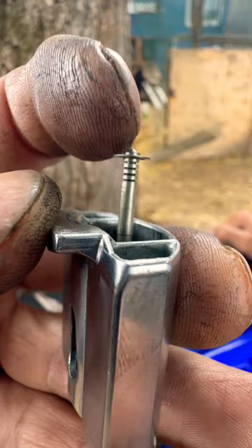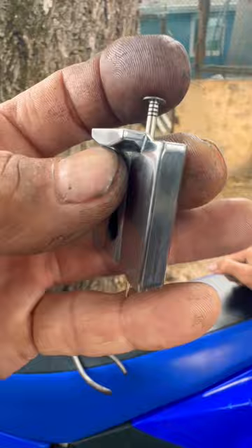If you want to shut your fuel off, you put the clip at the very top and the needle lowers itself. That's how you make the adjustment — take that clip off and slide it into whichever groove you want, then try your bike out. That's your adjustment.